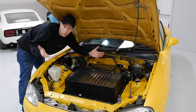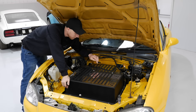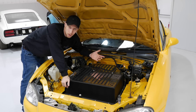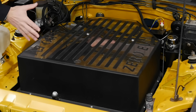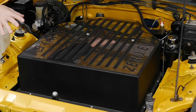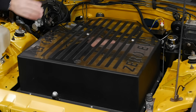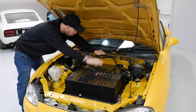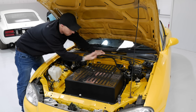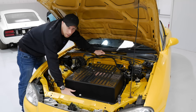Let's start with under the bonnet. This is our 26 kilowatt hour LG battery pack as you saw us build in episode 7. Everything is internal on this pack — we have 10 LG modules in series and an Orion battery management system. We have two contactors and pre-charge system, and also the contactor for the Hyper-9 system, all built within this pack with a couple of high voltage connectors on the bottom and a data connection.